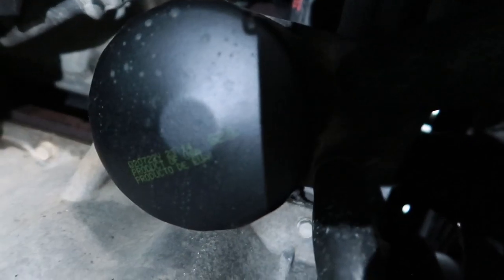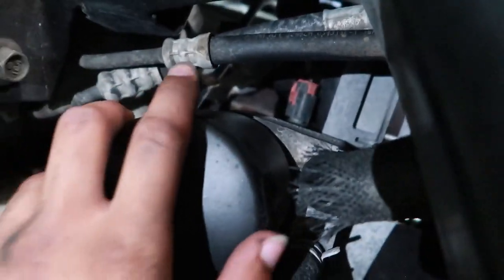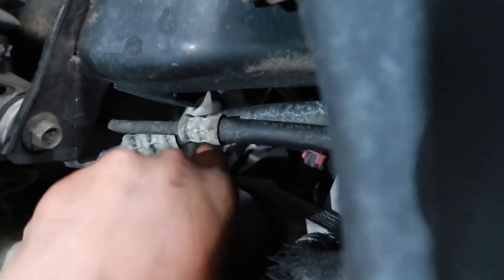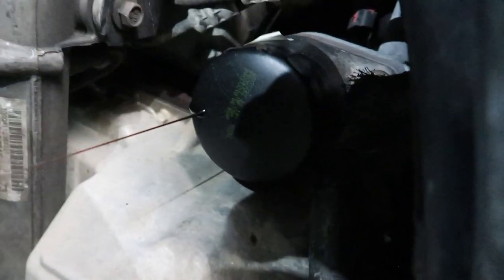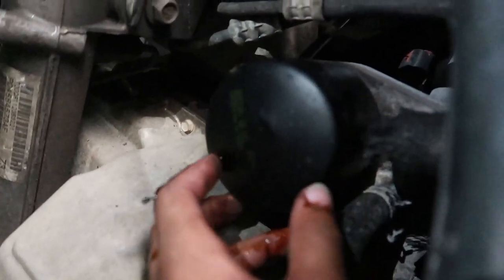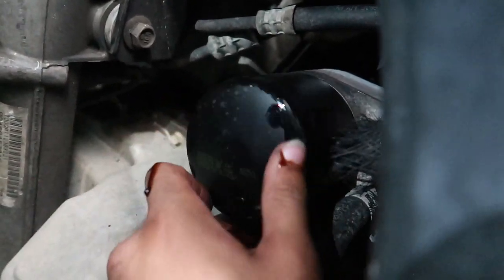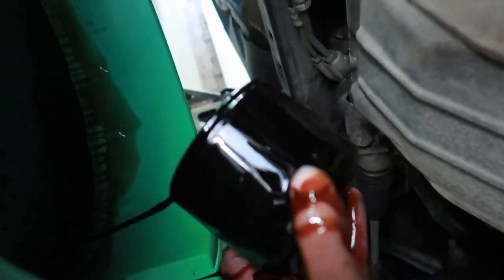Now that we got the bolt taken out and the cap off at the top, you're gonna want to find your filter, which is on the passenger side of the oil pan. Sometimes you can just reach your hand up and twist it off — I put this one on last time so I'm able to twist it off by hand. Move your catch canister up underneath it because she's already pouring out a little bit. You do want to wear gloves because as soon as it comes down, it gets all over the place. Drop the filter, put it in your canister, and wipe your hands off.